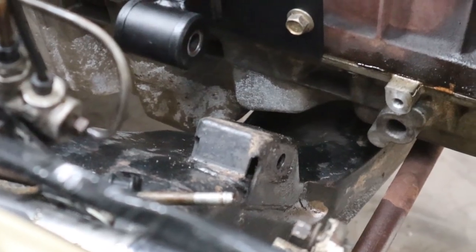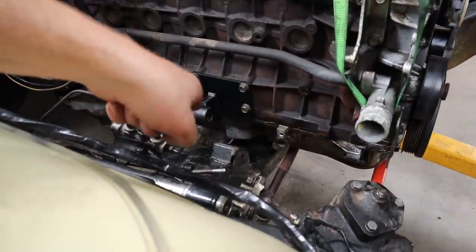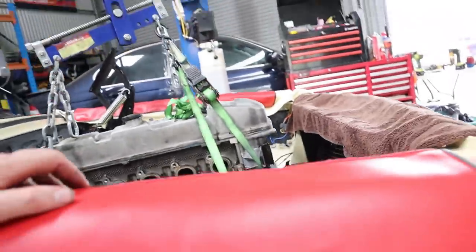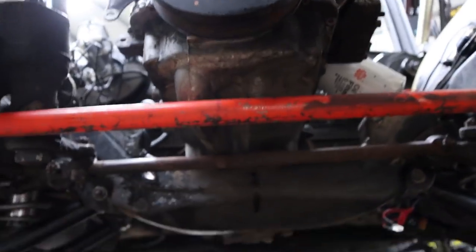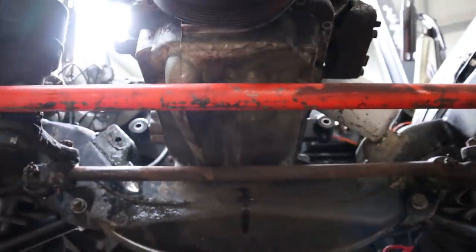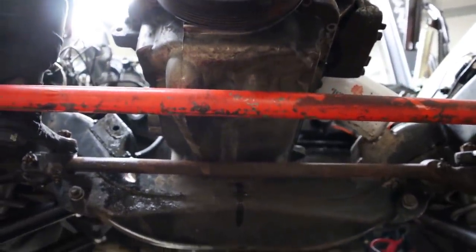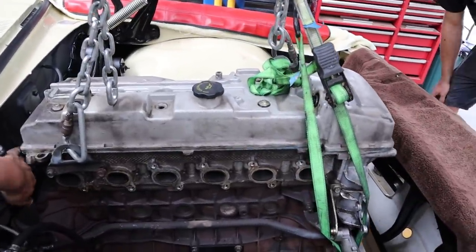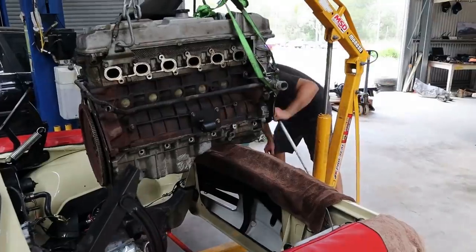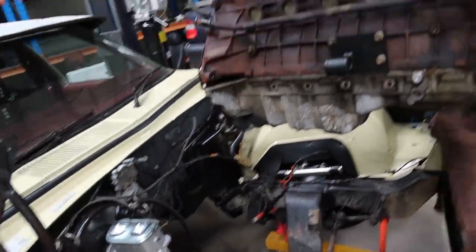So it definitely doesn't just go in. It's just hitting the back of the sump where it starts to go down into the hump, keeping it a little bit high. It's hitting the pickup tube lump there, so what that means is we probably can't come any lower — we're going to have to go up a bit. That's going to probably be a problem. I've got to pull this back out and start cutting up that sump. It's looking pretty promising at the moment though.